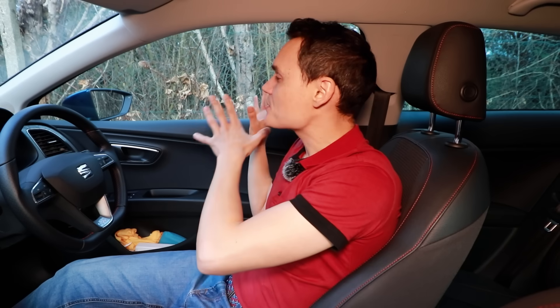My recommendation is: don't have the engine running whilst you are outside de-icing the car, because as explained in this video you're going to be breathing in harmful gases. I also don't recommend having people inside the car whilst you're outside de-icing, because their breath will steam up the windows rapidly, encouraging you to turn the engine on and the demisters on. They can wait outside with you or help you de-ice. I especially don't recommend having children inside the car with the engine running and demisters on, because if the wind is blowing exhaust fumes to the front of the car, the heater fan is going to blow those fumes into the cabin.